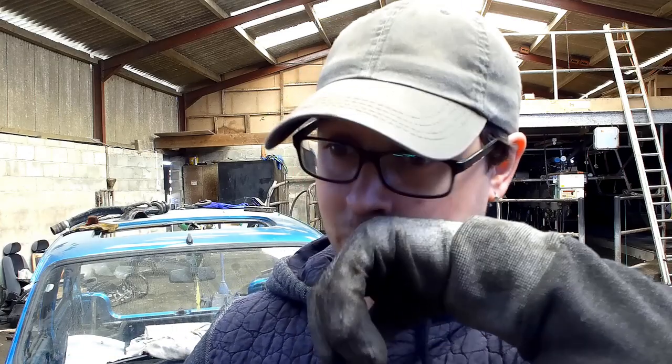It actually looks really good there. There's quite a nice bit of rake on the back. I'm going to lift the back up slightly more, but I'm going to do that just by pushing the subframe down. I'm not going to mess with how the shocks are. The rear shocks do need a plate at the bottom, because they're only just catching.